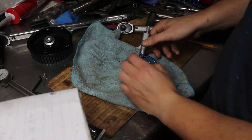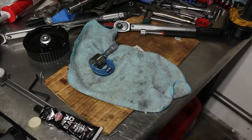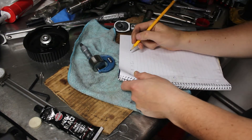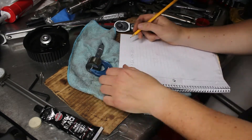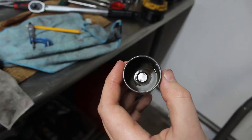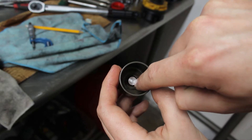Unfortunately, due to the way these heads are designed, you have to swap a whole new lifter bucket in place to change the clearances. The machine shop can grind down the valve stems, but most people don't have a way to do this on their own, and it only works for increasing valve clearances. So I take my micrometers out and measure all the buckets that are out of spec, writing down the details in my notebook as I go along. It looked like one bucket had been ground down, so I'll be replacing this one.